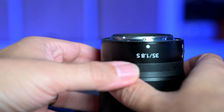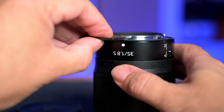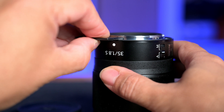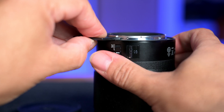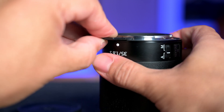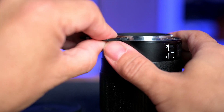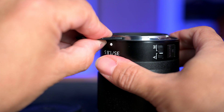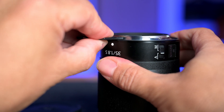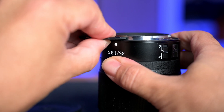I've got an SD card here and I'll show you two things. First, I'm going to slide the SD card in along that flange — it's actually nearly the perfect size, simulating how a lens would fit into the mount. Now if I just lift that up fractionally and pull it along here, you'll see it goes away — bang, stuck! So that leaf spring is sitting just fractionally proud, catching the edge of my 35mm f1.8, and that is what's causing the lens to jam.